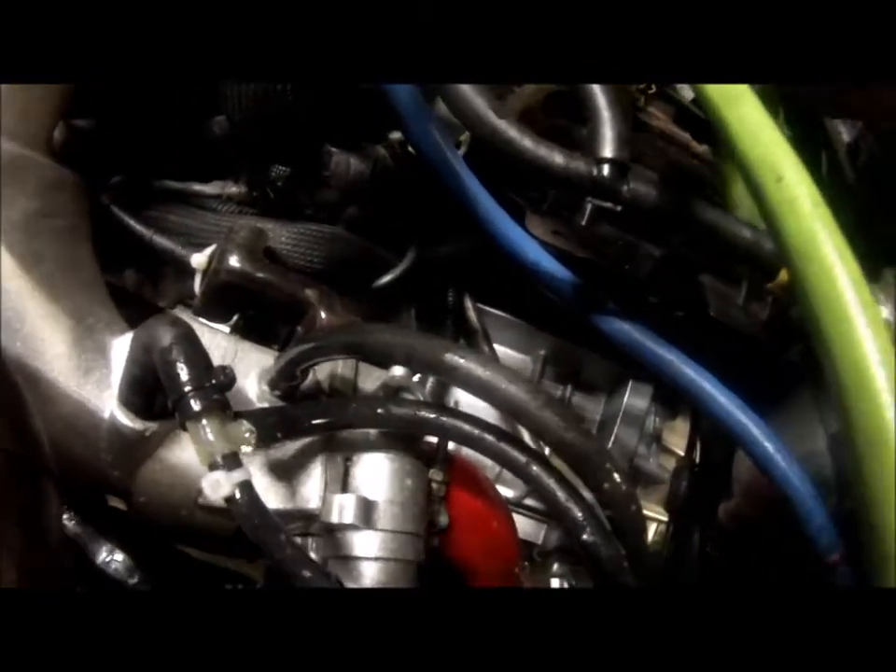Because of those little leaks I decided to check everywhere else, which is what you're supposed to do when looking for boost leaks. The bottom of that coupler down here is where the issue lies. If I spray — see the air pushing it out — it's the coupler, which means I need to reposition the coupler and tighten it down.